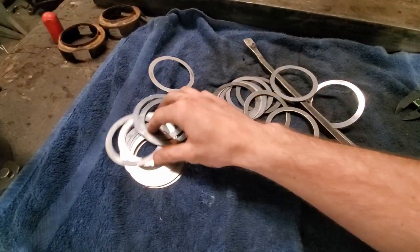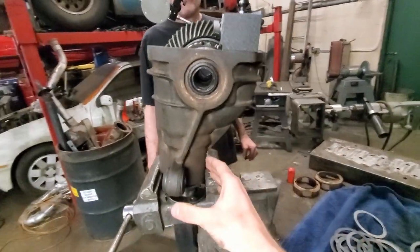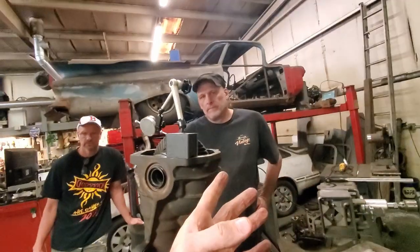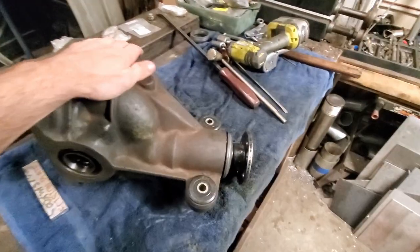These are all the shims I got. Talking with Liddy, we've done a ton of research trying to see what shims we can get for our differential. This is an R200V - not the long nose R200 that goes in most 240s, this is in a 300ZX. First things first: our diffs do not use a crush sleeve. I talked to Z1 Motorsports and they said our early-style R200 diffs do not use a crush sleeve. That was the first thing I talked to Liddy about - he thought maybe it was a crush sleeve and that's what we were having an issue with for pinion depth. That wasn't it. After a few days of frustration, we got this figured out.